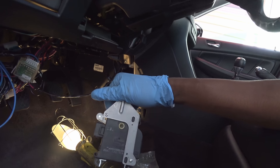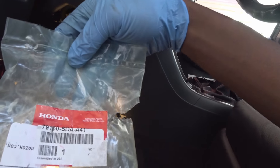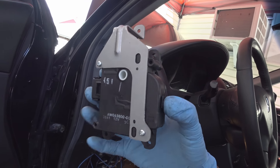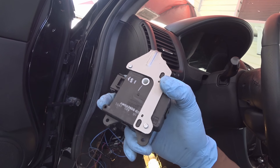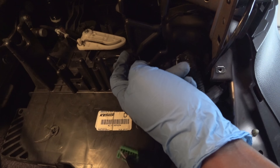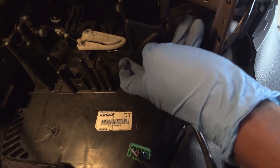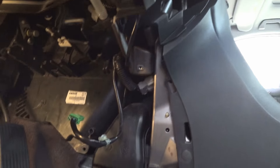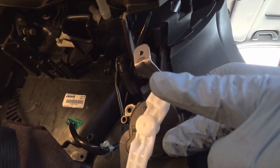I'm going to show you how to put it in. This is the new one — same part number as the old one. It goes in like this and is bolted in with one Phillips screw here, here, and here to hold it in. That white clip controls the flaps internally, and this black one is also part of the blend door motion that gives the temperature on your side.